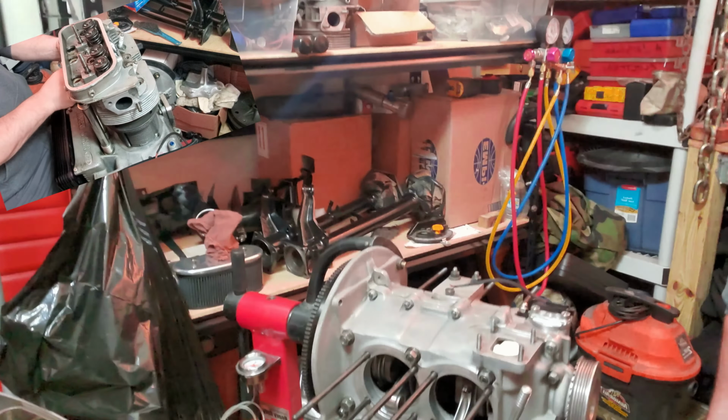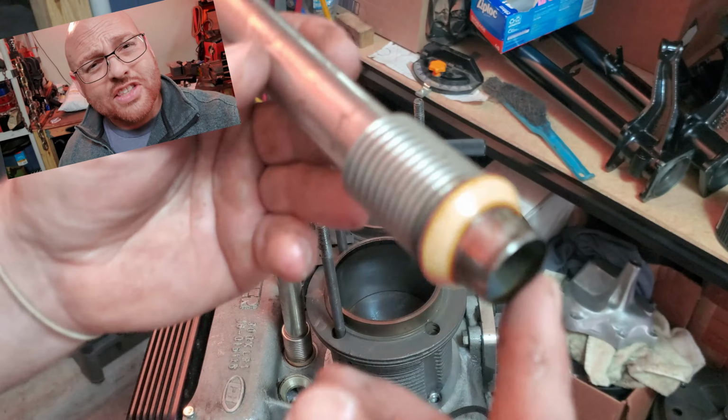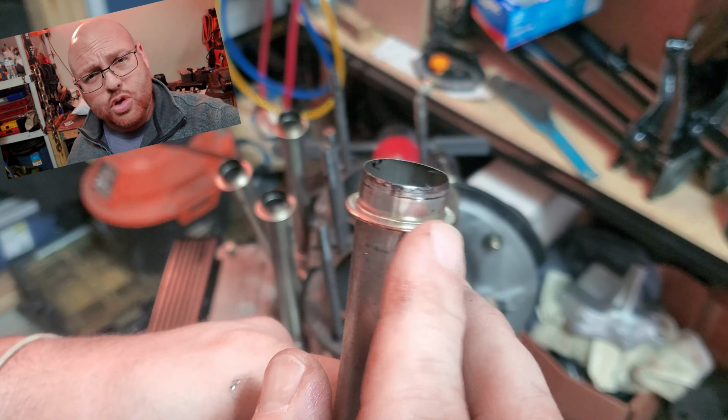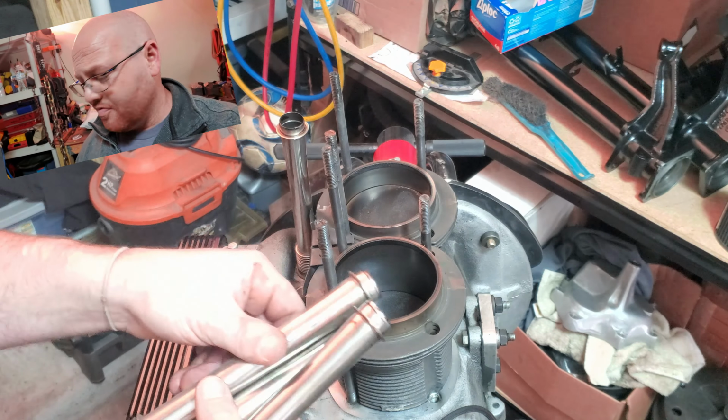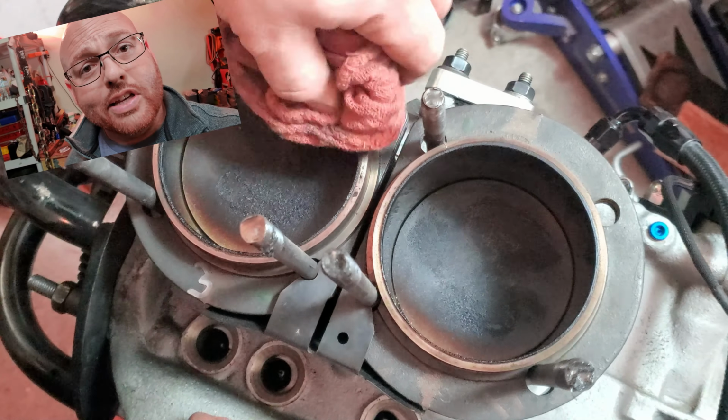I'm trying to get this video done for you guys and get it out to you tomorrow morning, sometime, hopefully. Well, in the last video, we started the breakdown of the 2287, I believe I said. Well, that little monster down there, guys. Oh, baby. I was a little bit wrong on that. It's actually a 2180. Not an 86 crank, but an 84 crank with VW journals, because an 86 crank that's a flanged fit from CB Performance would be, you know, Chevy type journals.